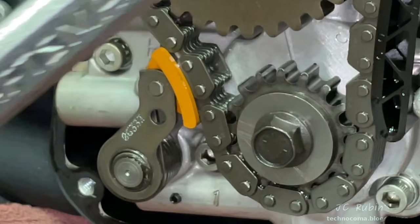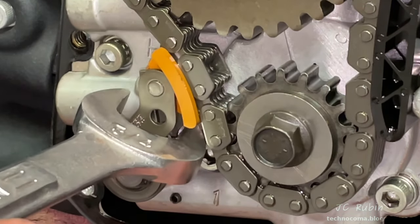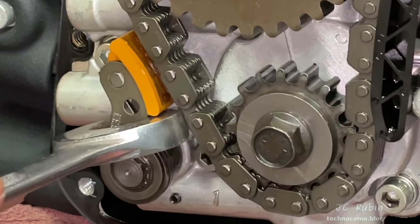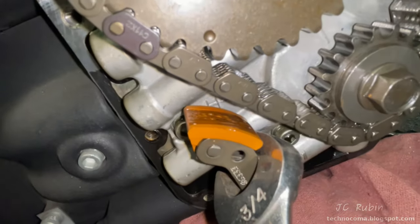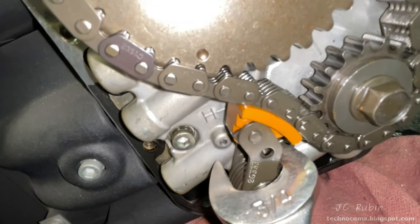The front tensioner is worn to much less of an extent than the rear, but still worn. I'll use a three-quarter wrench and a vise grip to open up the front one so we can get a good view of it. As I deflect it away, we can see that it is worn and pieces of it are also gouged away — not good.